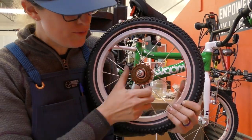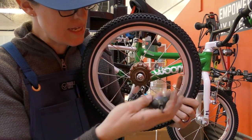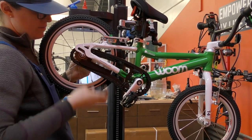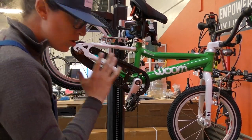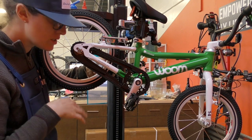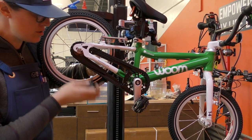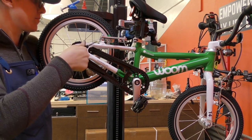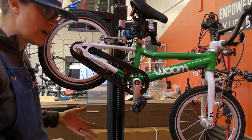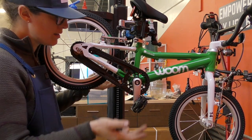Here is the freewheel wheel and all I need for this is a 3-way — you're going to need a 5mm Allen to install this wheel. Make sure all the teeth are engaged on the chain with that chain looper, then pull it back so it's snug but not too tight. Snug down the right side first, then make sure the wheel is centered, tighten down the other side, triple-check the bolt nuts, and engage the brake — we should be good to go.